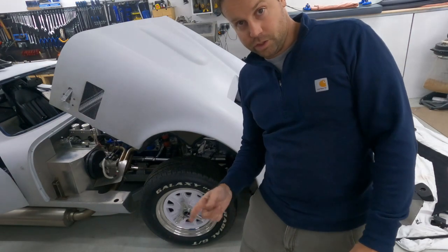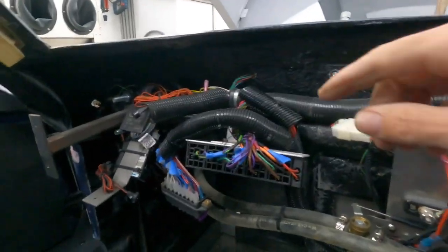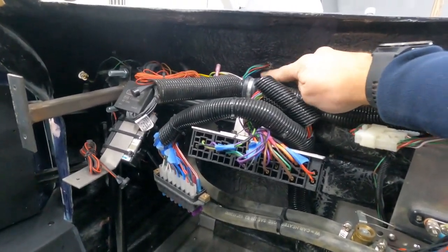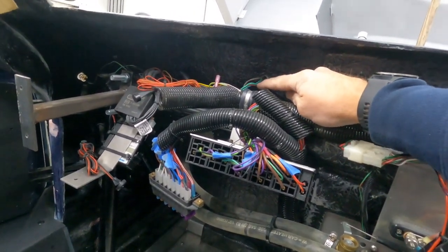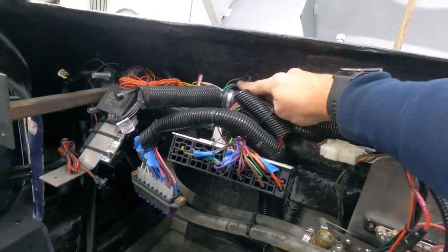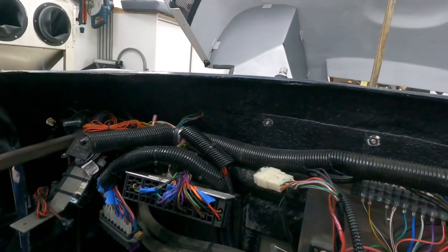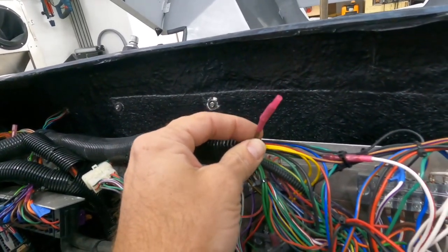The bonnet's up and I'm on the wiper motor issue. These are the wires that pass back into the cockpit from the wiper motor - there are five cables: black, red-and-green, blue-and-green, green-and-brown, and green. The blue-and-green and the red-and-green are the fast and slow. Black is ground, green is ignition live, and the brown-and-green is the park cable. I've found what I did with it - I terminated it, because my mindset when I originally wired this was that the wiper switch was just off, slow, and fast. I'd never done this before so I didn't know I needed a park signal.